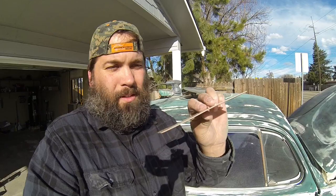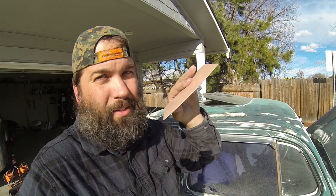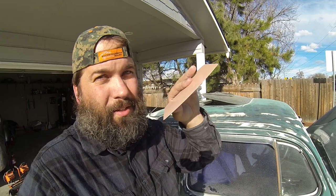I wanted to go over a little bit of how to apply body filler with the spatula on a round plane. This is flat — at least it should be. So if you imagine putting this on a round surface, it's not going to do very well. What I do is take my thumb and press it against my two fingers on the outside — it creates a curve. I curve the spatula to the angle of the body and I'm good to go.